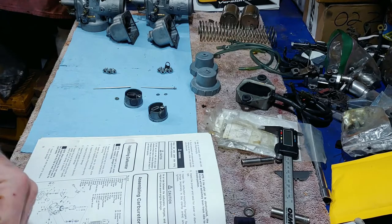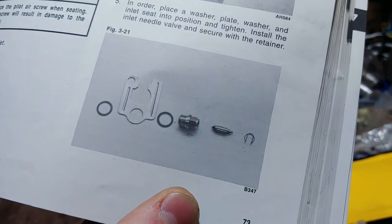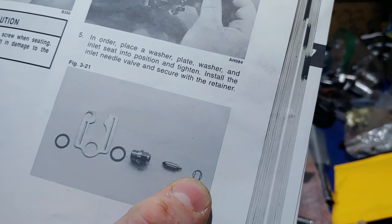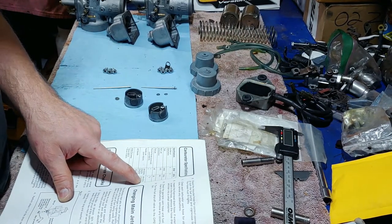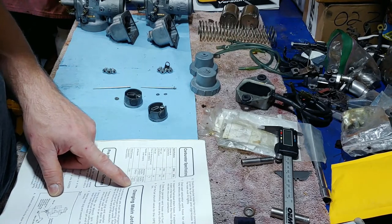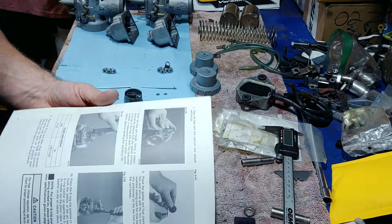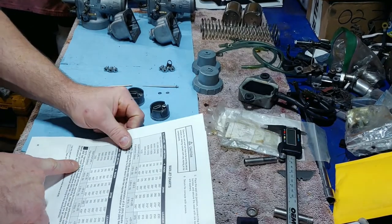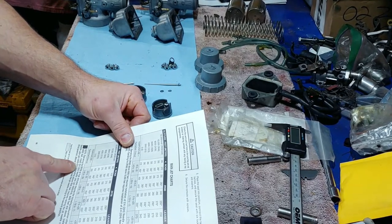From the manual: install a washer, plate washer, and inlet seat into position and tighten. Install the inlet needle valve and secure with a retainer. You've got washer, plate washer, valve needle, and retainer. Needle jet is AA4 for the 700s. Then the jet needle is 7DJ2 dash 3 — wait, so it is supposed to be in the third position. Let me double-check that chart. High-altitude operation of the ZR above four thousand feet requires raising the jet needle circlip to the third position.